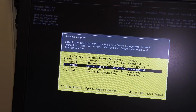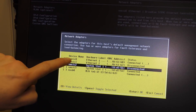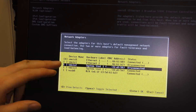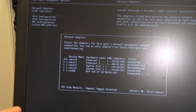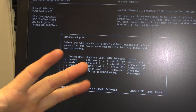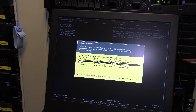I'm looking at the different network possibilities inside VMware 6.5. At the top we have the two 1 gigabit ethernet cards — Ethernet 1 is connected and that's what we're running on right now. Then we have VMware NIC 2 and VMware NIC 3 in system slot 1, which must be where I put that PCI card. I can see I put it in VMware NIC 3, meaning I put it in the wrong port. I'll change it anyway — I'm wondering if this will change while I record this.